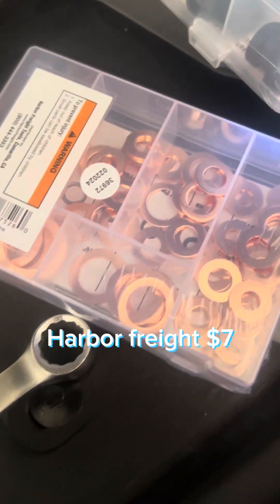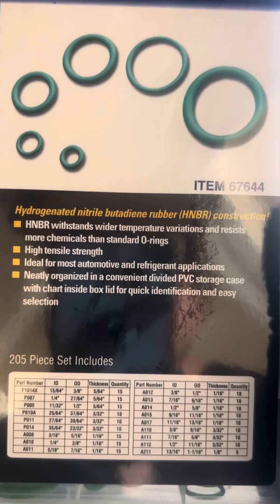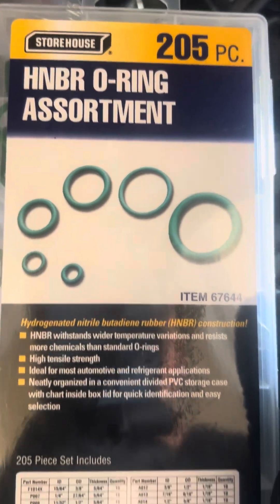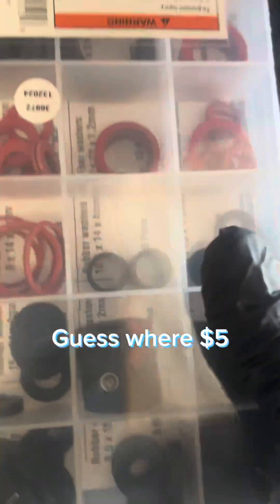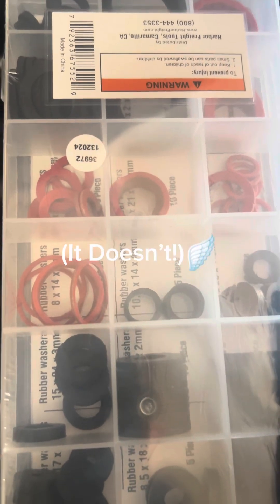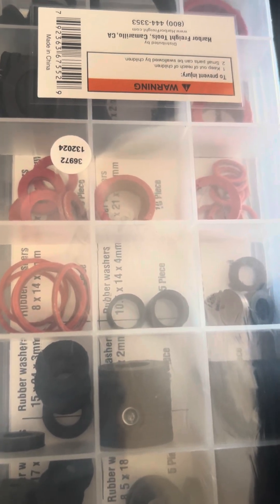There's a PPI tool that you can actually bore this out, drill and tap it, and put a whole new seat in there, but I'm going to try this out first to make sure there's nothing else wrong with it. I have these washers — they're called hydrogenated nitrile butadiene rubber. The packaging says they withstand wider temperature variations and resist chemicals. I was going to try to substitute this for the teflon ring, because those just blow off immediately as soon as I put them in this motor. I also got a couple little seats to try on the decoupler ring, though that may screw up the ground of the injector.